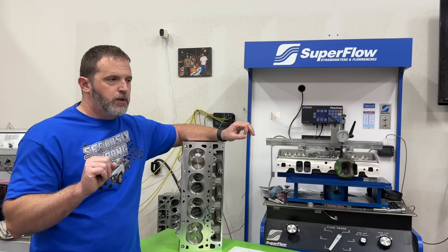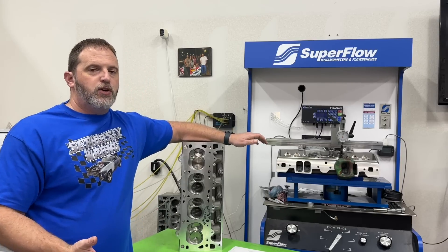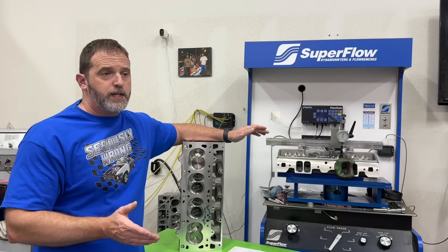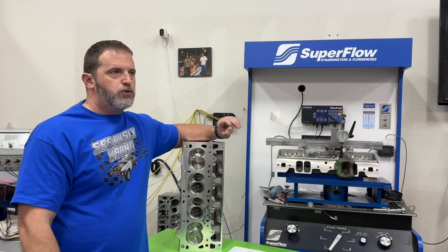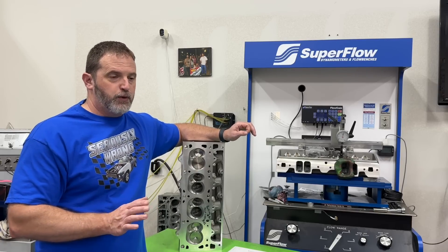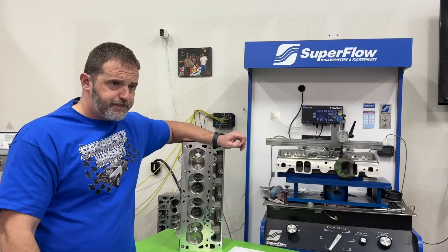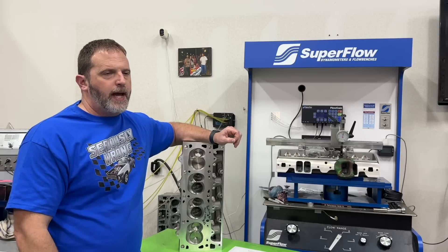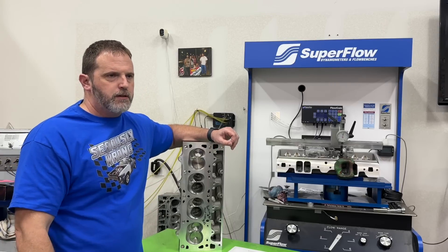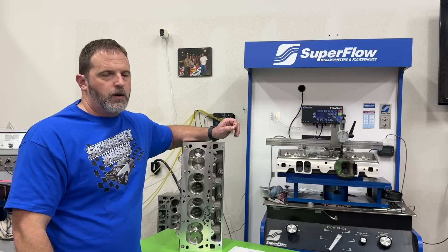This is only NA. So if you're thinking you're not sure whether to switch, it's going to make you go faster, and especially if you're running 13 to 1, it's way cheaper than race fuel — even drum E85 race E85 is still cheaper than drum 110. Do not confuse this with power adder, because 100% you should run E85 on a power adder. If you're doing gas on a power adder, at least switch to E85 — the gains are way, way more. The prime example is the S10. On a power adder deal, E85, 100%, no doubt. On an NA deal, if you can't get it, you're not that far off on power from the 110 — you are on torque, but not power.